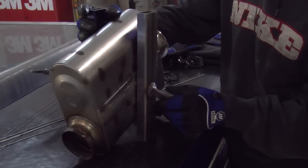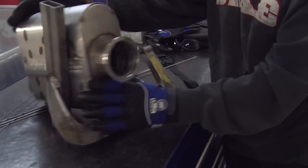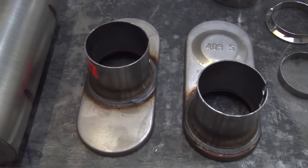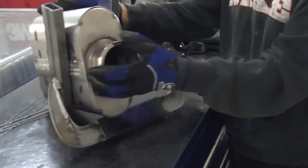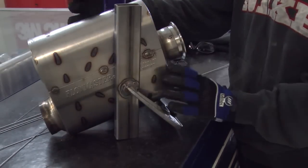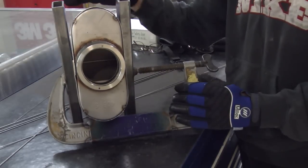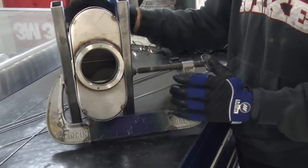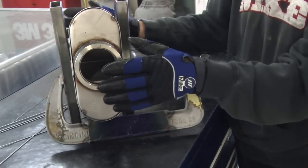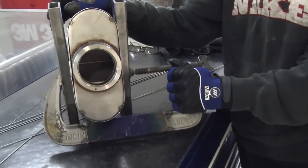It's a three-chambered muffler that they provided to us with the internals in it. The end caps were left off. I've shortened the muffler up. We've basically stuffed the end caps into them and we'll be welding up the seams on both ends of the muffler and the main seam down the middle. We have a nice set of SPD flanges and we actually shortened up the inlet to condense everything as much as we possibly can so that we can get it up into the car.